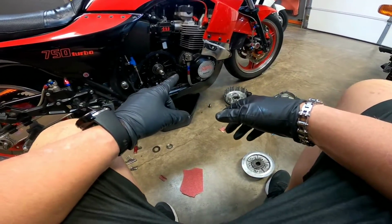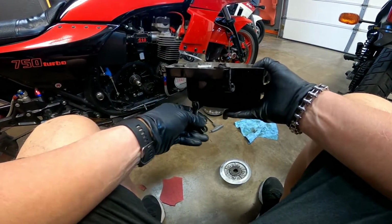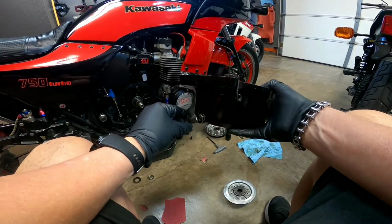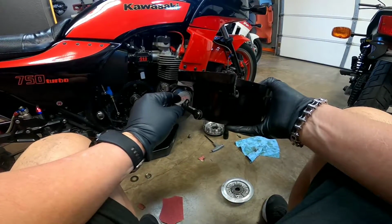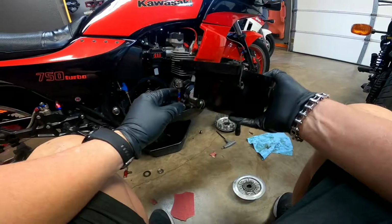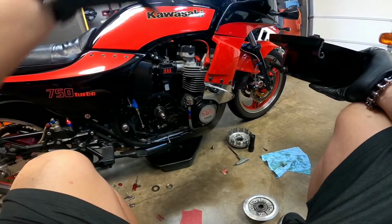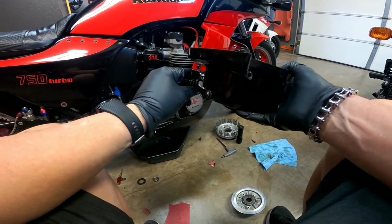What I did was I put a pair of vice grips on the actuator for the clutch, and you could actually feel it in the clutch, like right here. You could feel it just kind of be like, I don't know how to describe it, but that led me to believe, well, one, what that did is it eliminated the hydraulic actuator right here. It eliminated that, and it eliminated the master cylinder. So it was something definitely in the disengagement.